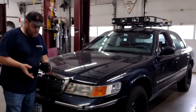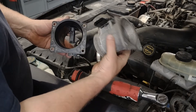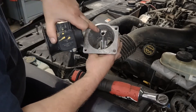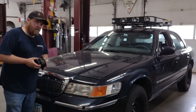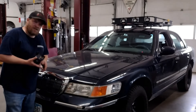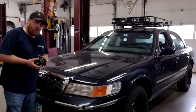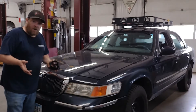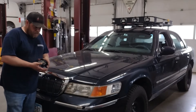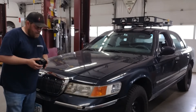The next thing I ran into was that the mass airflow sensor had failed. I found that a mass airflow sensor out of my '96 Ranger bolts right in and seemed to be working fine, but over time I've noticed that it loads up a little bit and just doesn't seem to have quite the power it did before. I'm wondering if there's a calibration issue with that sensor, so while I was at the junkyard today I picked up a mass airflow sensor off a like car and we're going to give that a try today.